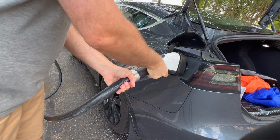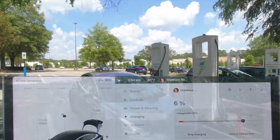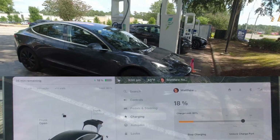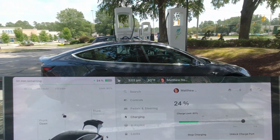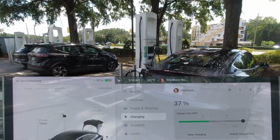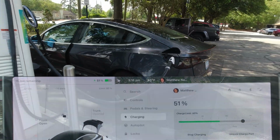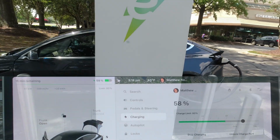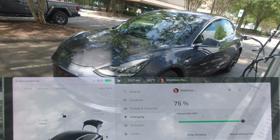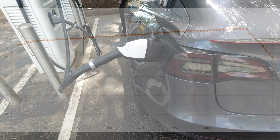They all are 150 kilowatts, and I have checked PlugShare for the most reliable ones to try. I even asked some people charging, and they mostly get around 90 to 100 kilowatts when they charge here. And of course, charging speed depends on the CCS station. Note that there are 50, 100, 150, and 350 kilowatt CCS stations. You will be limited by the max kilowatt rating on the station. You will not get the full kilowatt rating on a Tesla due to the volt and amp requirements.